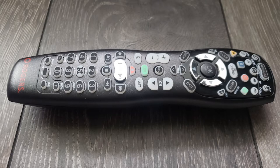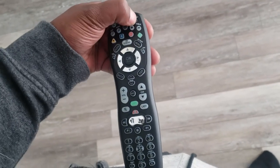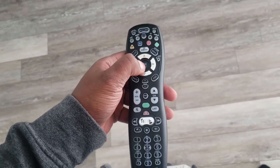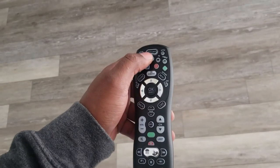What's up everybody, today I'm going to show you how to program the Rogers Champion 2 remote. First thing you're gonna want to do is hit the input that you want to program, then hold the setup button until that input flashes red. Once it flashes red, just hold the OK button until your device turns off.